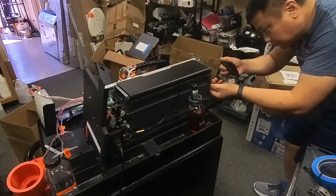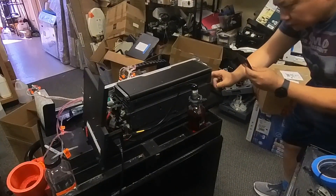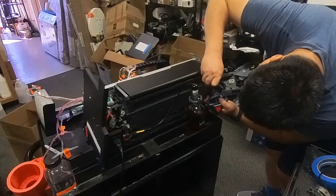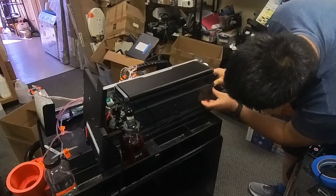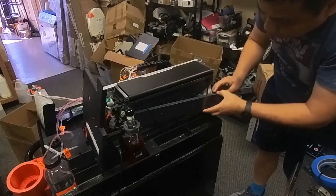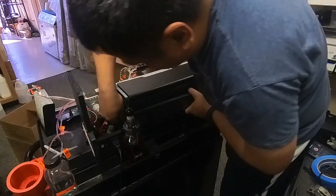This capping station has a motor, so the motor wire goes all the way to your right on the mainboard. Therefore, we need to remove this unit with the wire. There are two release tabs, one on each side. You can just use your finger, dig it in and release that tab. There are four tabs in the back, but I usually just release one side and jiggle up and down and it will release itself. Now I'm working on the last tab — the side tab — and I release it and the whole thing can come off.